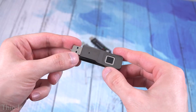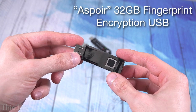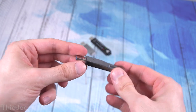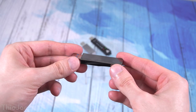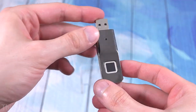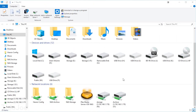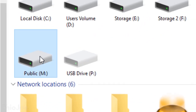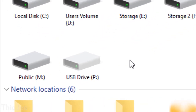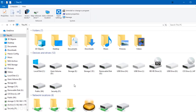The next type of drive is this one. It's called the Aspoir — I'm not sure if that's pronounced right. This is a 32 gigabyte fingerprint encrypted drive. There aren't that many fingerprint drives on Amazon or on the market. It's got pretty nice all-metal construction at 32 gigabytes. The neat thing about this one is it actually has two different storage enclaves: a public one accessible whenever you plug it in, and a private one that can only be accessed when you unlock it with the fingerprint — that one's about 20 gigabytes. It has similar read and write speeds, about 30 megabytes per second read and 15 to 20 megabytes per second write — a little bit slower than the Kingston.